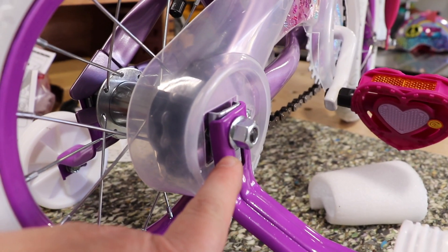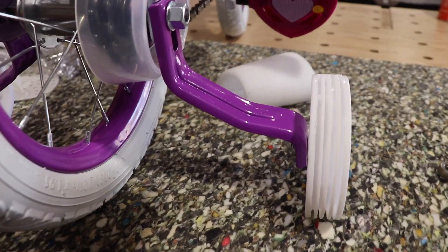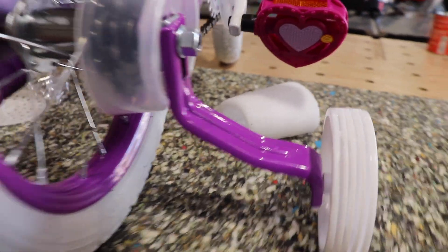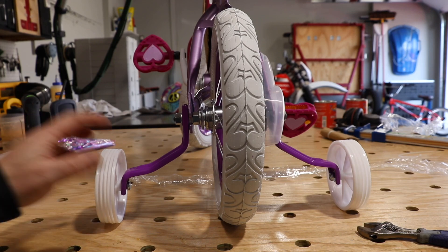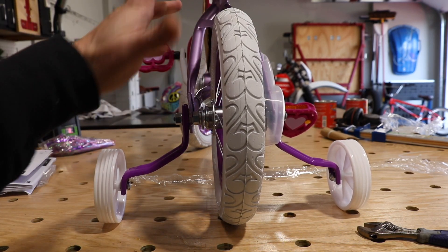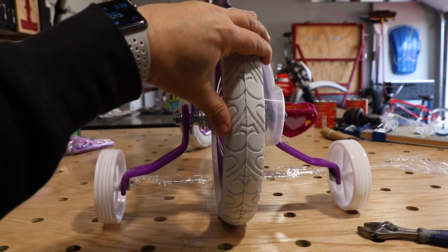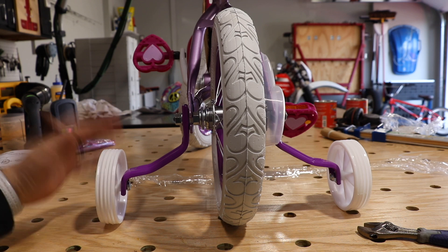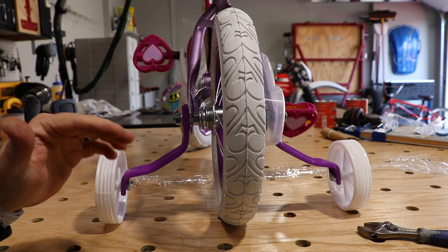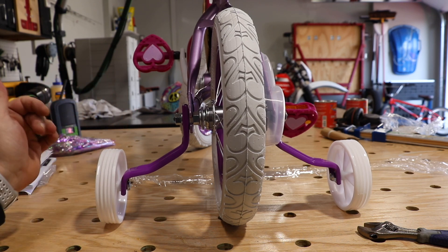Now the first thing you want to do is make sure you have the same amount of space on either side of the wheel. If you have a gap on one side, your poor child is going to be riding the bike down the street lopsided, and I see that all the time. But you don't want them both touching the ground right now — you want a little bit of space. The tire is what makes contact with the road; these are simply there to balance them — one side touches, the other side doesn't. You don't want to wear out the training wheels super quick, and also these are training wheels — they're not third wheels for your kid to ride around on. These are supposed to train them on how to ride a bicycle, so that is one thing to keep in mind.